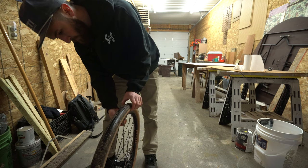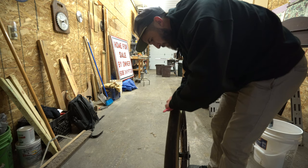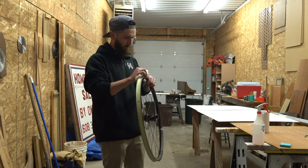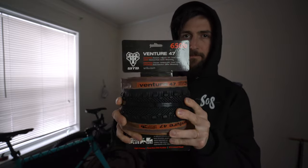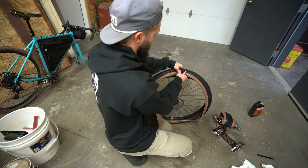While I was at maintenance, I deflated my old tubes, took off the tire, took off the tubes, cleaned the rim with isopropyl alcohol, and was ready to set up the tubeless setup. The thing I did not do the first time that I should have is kept the tube in while I inflated the new tires. With a new tire, I had a bit of a problem trying to get the bead to sit because they were folded up in packaging to be shipped, so they didn't have that natural circular wheel shape. I fixed that by adding a tube, inflating it, giving it the shape, then taking the tube off, adding the tubeless valve, and going from there.